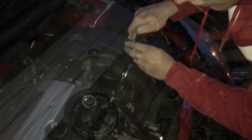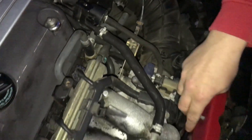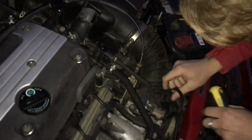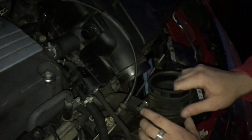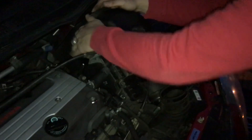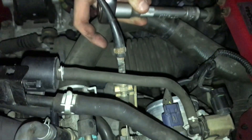Remove it from this end. You're going to want to loosen off your jubilee clips. Also, you want to make sure your air temperature sensor is out of the way, because you don't want that getting damaged — otherwise you'll have fault codes showing up. So, we've disconnected our main hose from the box. Big old airbox — it's absolutely giant. So now we just want to slide the main tube off and there we are. That's the old airbox out. There's another 10mm there which gets your old pipe that connects to the back of the airbox out.